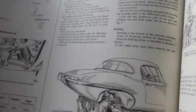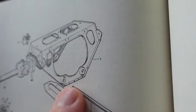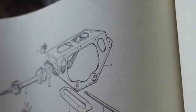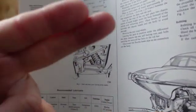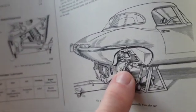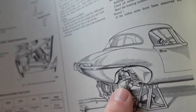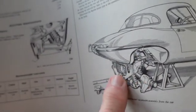In order to service the rear axle, you just take the cage out. It actually comes out pretty quickly. It's amazing. There was a little dent right here on mine where somebody had put a tow chain on it or something. But you basically just take off the brake hydraulic line. You take off the emergency brake cable. You take off the propeller shaft, and you take off the 8 bolts that hold the rubber bushings in, and you drop the entire cage.